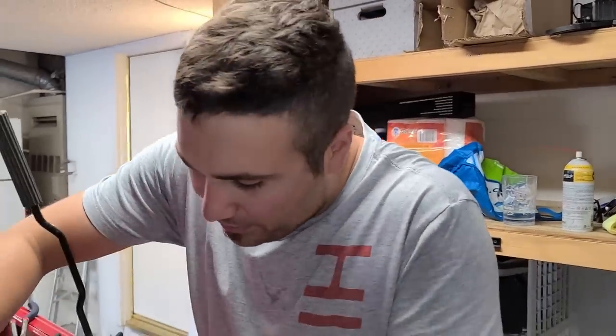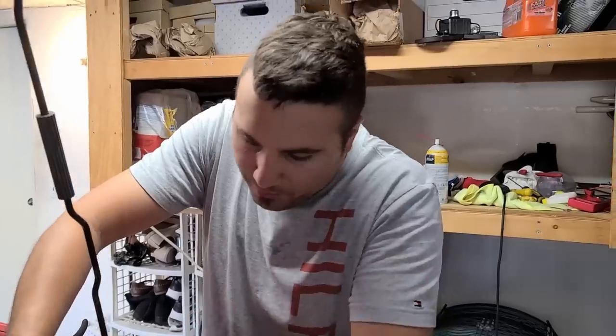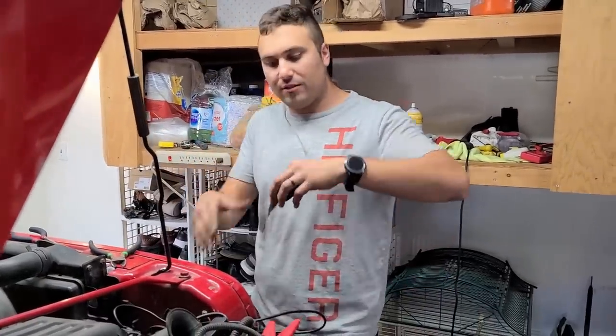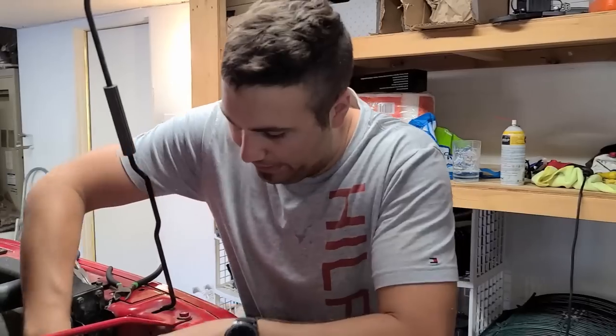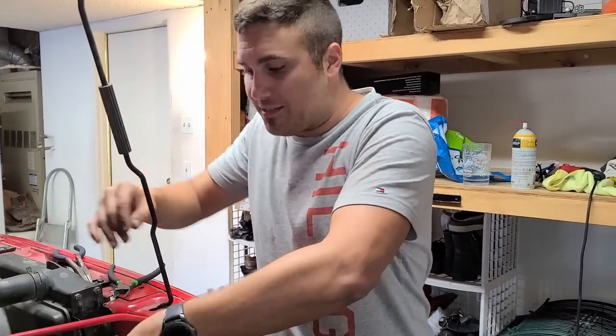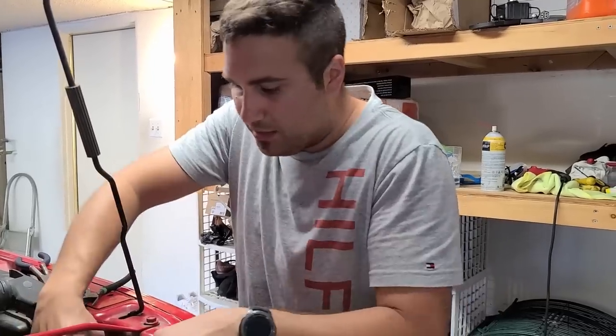So know that these little T-taps over here tend to go bad over time. When they wiggle, they might disconnect. So just drop a piece of electrical tape, and if the system stops working, this is your first place to look, FYI. There are better solutions to this, but this is the fastest. I mean, you saw it. It took just a couple minutes and we're in business.